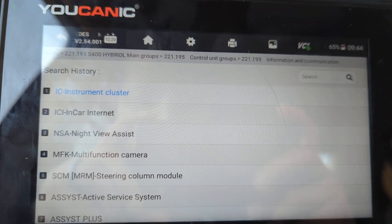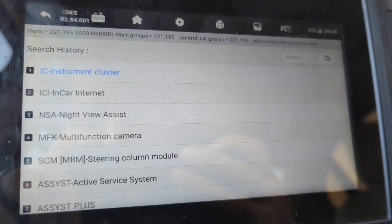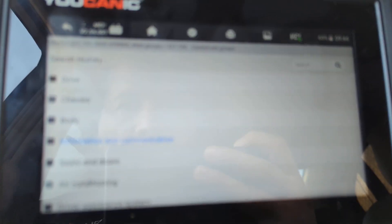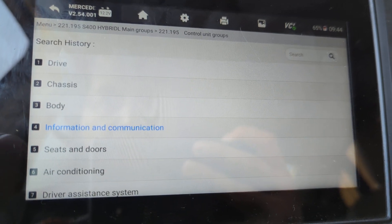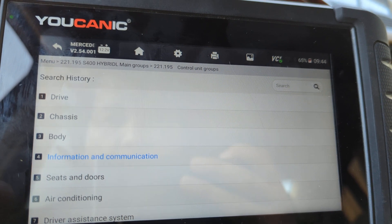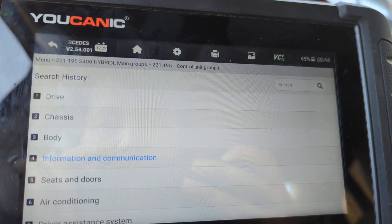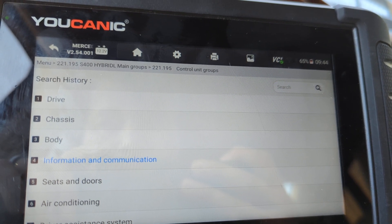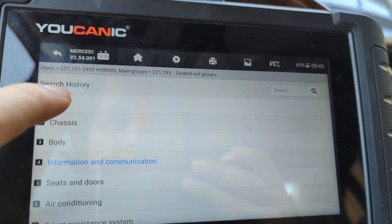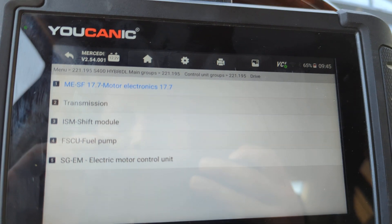The fuel pump is located in your fuel tank, but you want to figure out if it's working or not. You might want to have a way to turn it on and off so you can do some testing. Maybe you can check the voltage with a voltmeter, or you can be right next to that fuel pump. Typically, you just have to remove your seat cushion and then you see the fuel pump there. When the fuel pump is turned on, you usually can hear it if you're right next to it, or if you put your hand on the pump, you can feel that slight vibration on it.